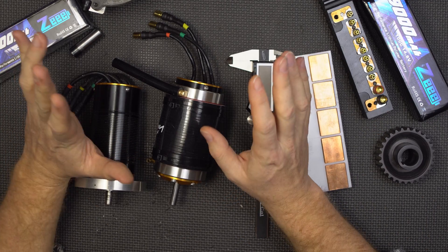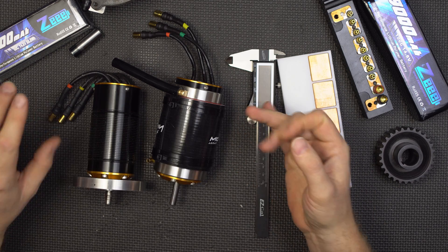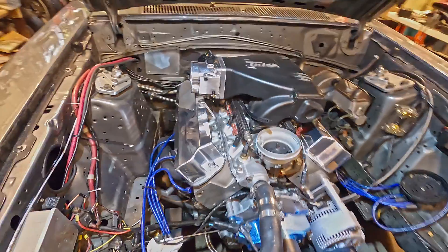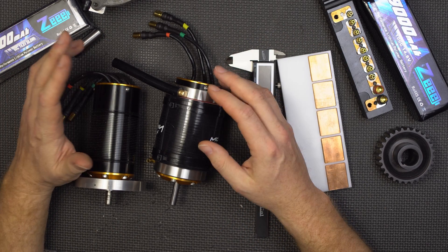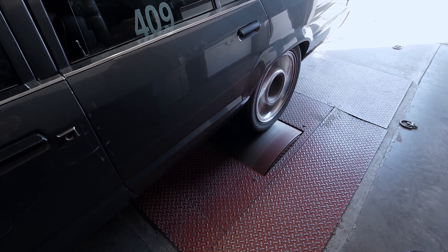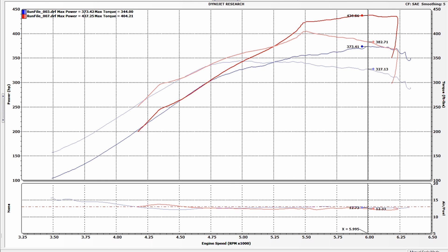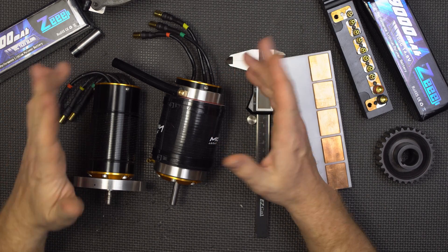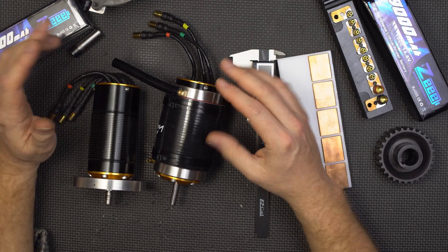The total bottom line for everything is $3,340.74. That does not include all the tooling, dyno time, the blower itself, or the upgrades to the car. So you're looking at almost $3,500 just to get two pounds of boost on a 500 horsepower motor. We saw rear-wheel gains of around 64 horsepower so far, but for this to really be considered successful we need to see triple-digit gains — 100 to 150 horsepower, maybe 200. I think the realistic limit may be somewhere in the 200 to 250 horsepower range at the flywheel.